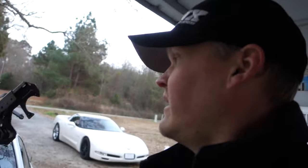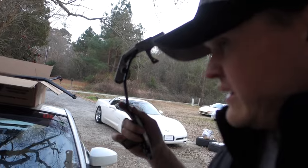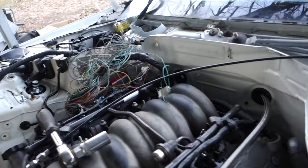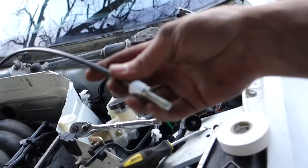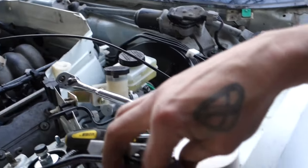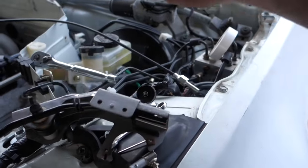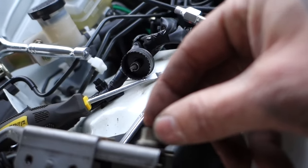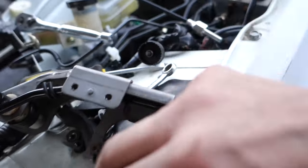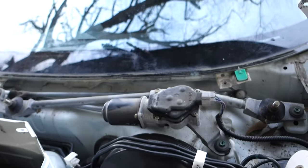And I got the fuel pedal, or the gas pedal, all the stuff off of it. And I got the throttle cable kind of laid in place, trying to figure out where I need to drill my hole. I was hoping I had a bolt that would actually fit, but I'm going to run to the parts store, get a nut, and weld a nut back here, where there was like a little bushing right here. So this line will just screw into the back of the pedal, and I'll drill a hole for the line to go through the firewall.